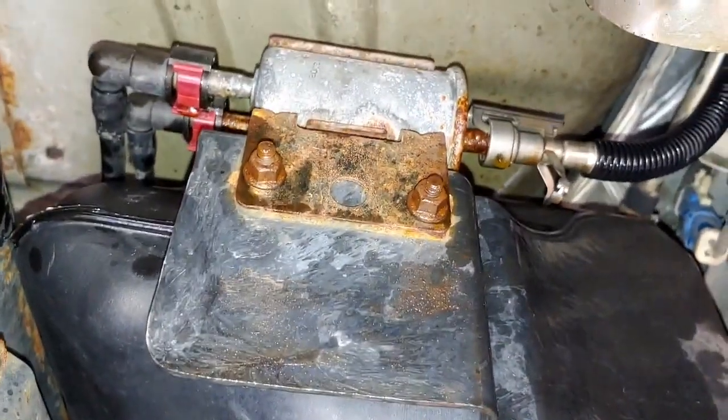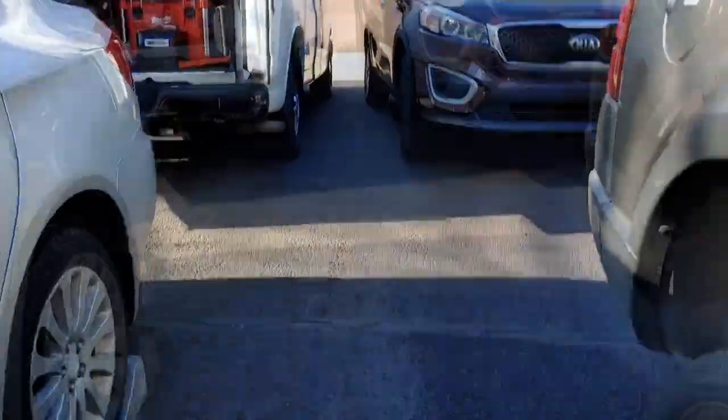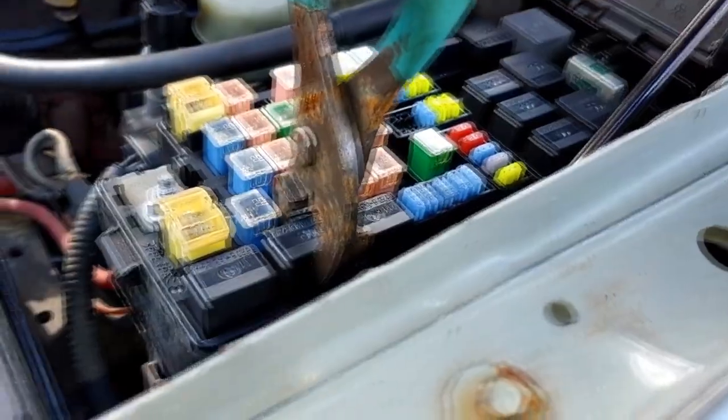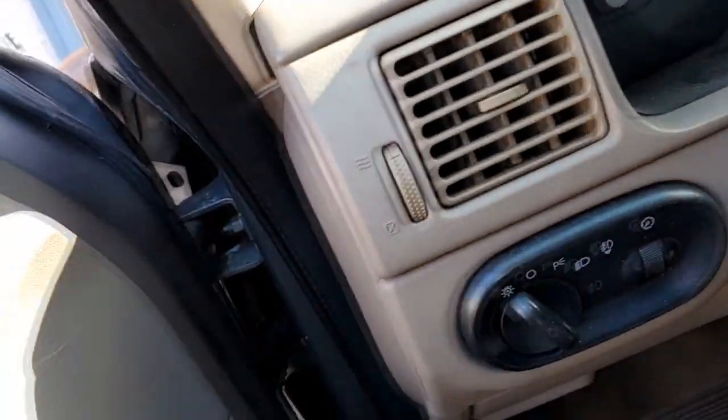Okay. I'm gonna pull the relay and I'm gonna crank it over and I'm gonna release my fuel cap so any pressure that's in there. So that should be good. And this one, the middle one, the one that's too tight for me to get my hands by. This right here, being as gentle as I can. Right there. Doesn't take much, man. This thing will not start with no fuel pressure.